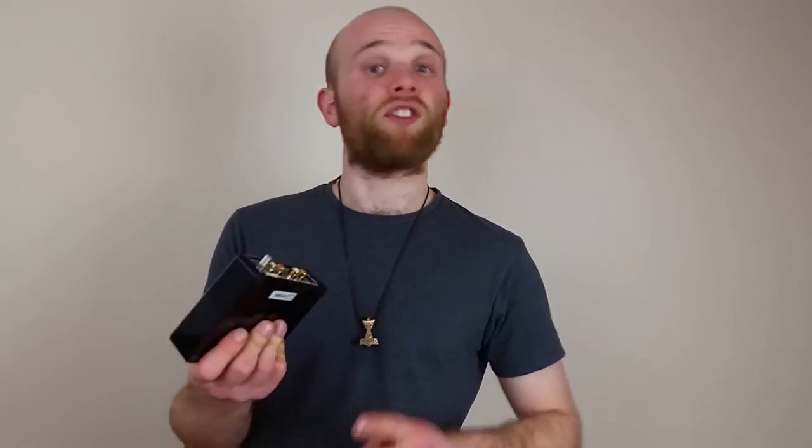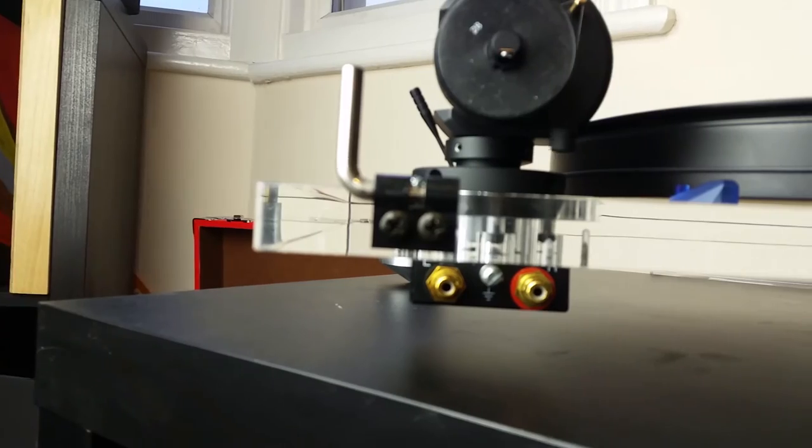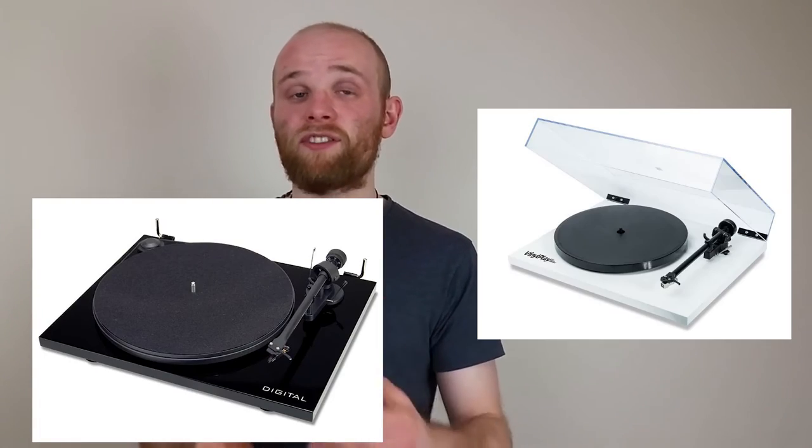So do you need a phonostage? Well, if your turntable is set up and working, then probably not — maybe your turntable already has one built in, or maybe your amplifier does. If you're unsure, there's a fairly easy way to identify it: if you look at the back of your turntable you'll see your red and white output — your phono output — and you'll also see an earth or ground output that goes from your turntable to the back of your amp, which cuts out a hum if it's not plugged in. Typically it's more basic turntables that come with built-in phonostages, although today companies like Pro-Ject and Flexson have started developing turntables with them built in, presumably aimed at people with Bose systems and soundbars. It saves you one more box, but at the expense of flexibility — if you upgrade to a proper hi-fi system in the future, you can't use your amplifier's phonostage or upgrade to a better one.